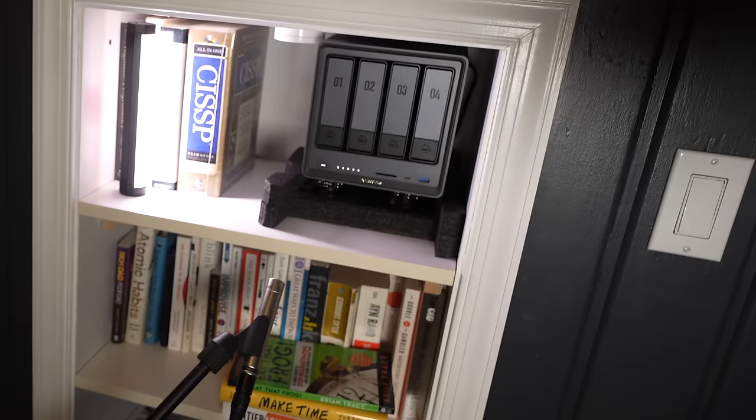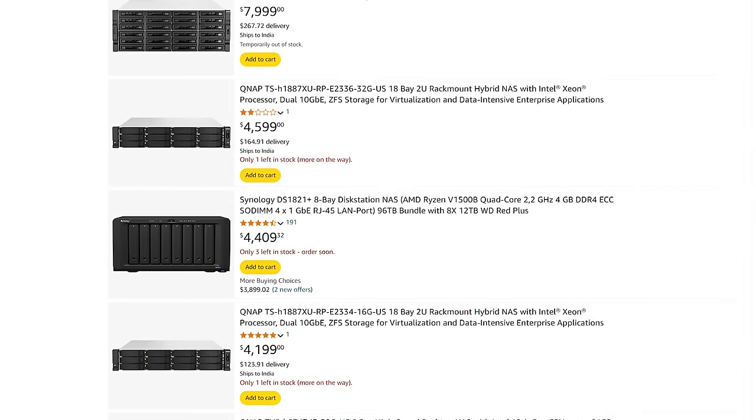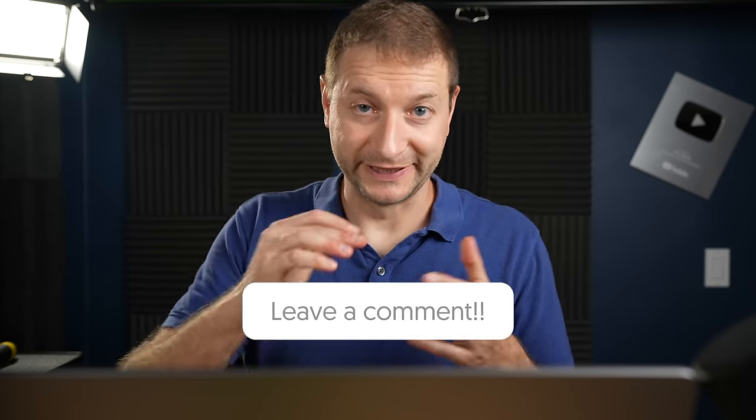Hopefully this might help anybody out there with a similar issue. If you're hearing these kinds of problems with your own NAS or DAS, you could use these little pads. You can use a combination of foam with the pads — basically the more isolation you do, the better, generally, up to a certain point. There are some NASes coming out that are SSD only — there are already some out but they're still pretty pricey, and some new ones are coming out in the fall. Let me know in the comments if you're interested in that. And if you missed my video about the DAS and how I tried to extend it using long cables, you can check it out right over here. Thanks for watching, I'll see you next time.